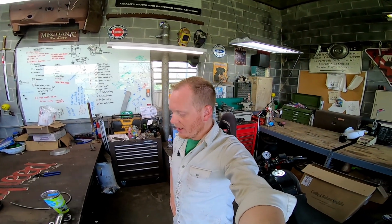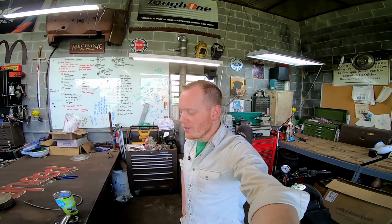But first things first, what I need to do is actually make these fit the heads, because they were the cheapest ones that I could get from China, and apparently they just don't bolt up to the heads or anything. They're originally for a C10 from the 80s. They're long tube headers, and I kind of figured, well, it's a big truck and there's no engine mount in the middle. It has the horseshoe thing on the front, so I was assuming that they would bolt right up, or that there would be enough clearance. But you know how that goes.